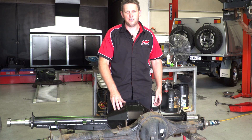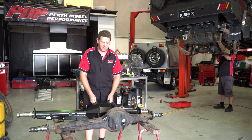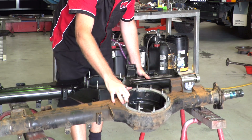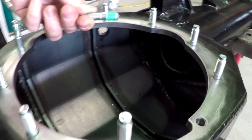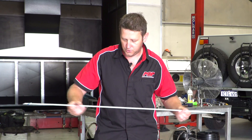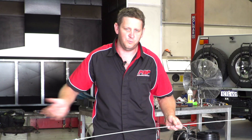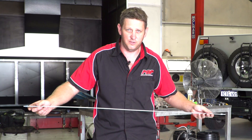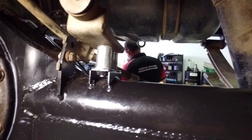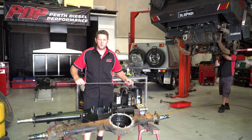It's designed to be generally a bolt-in kit. How we fit them here at PDP, we put all new studs and U-bolts — everything is new. When it comes to the brake lines, they come straight and do need to be bent out to suit the vehicle. It's not a bad time to upgrade your brake lines as well, because we'll bleed the whole brake system anyway. It's also a good time to look at the height on your proportioning valve on the rear — it's something we see where everyone's got a lift kit but they've never adjusted it, so that'll give you a little bit more braking force to the rear.